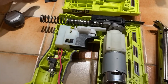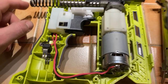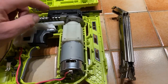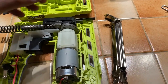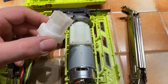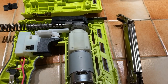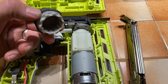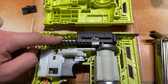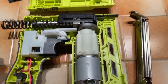The gear has a mechanism — a screw — that sets the spring tension, which allows the force to push the shaft down and insert the staple. However, I'm finding these are kind of broken. It looks like it's been skipping and there are tracks in here where it's gotten pushed off, so I'm not able to adjust it.